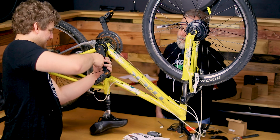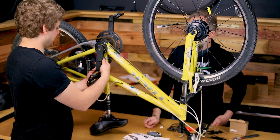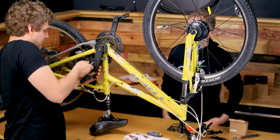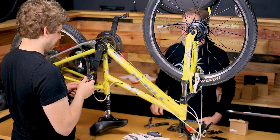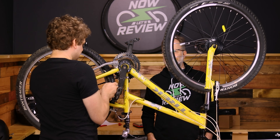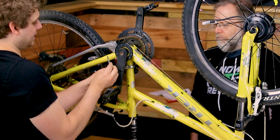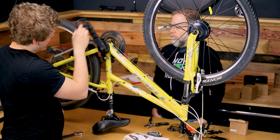Still so much movement. Maybe another zip tie. What's also not helpful is that this pedal is tapered, which means the further it slides down, the looser it gets, and the further up it goes, the tighter it gets. I think one thing you can do is wrap the zip tie around something strong, then you can really crank on it. You don't want to grip it with the pliers — it'll create a stress concentrator, whereas wrapping it around won't. Learn something new every day. This does seem like a weak part of the design, but I'll withhold judgment and wait and see. Because if it has a throttle, I'm not going to be as displeased.